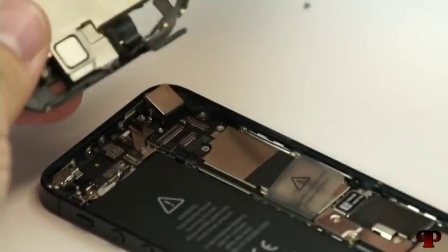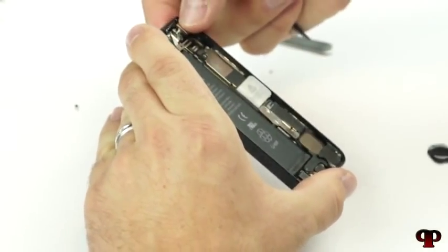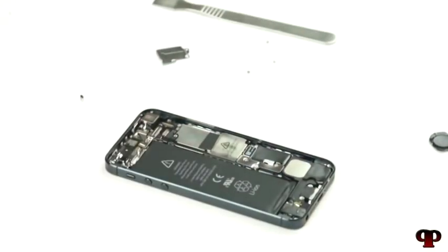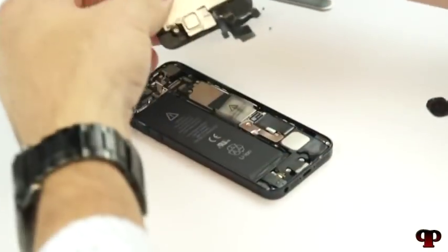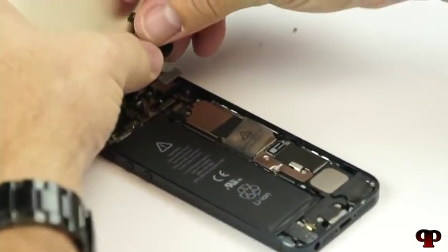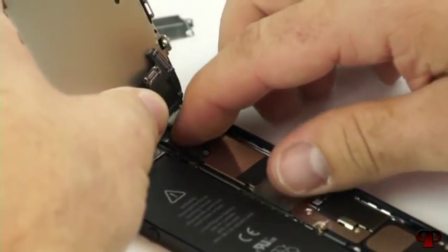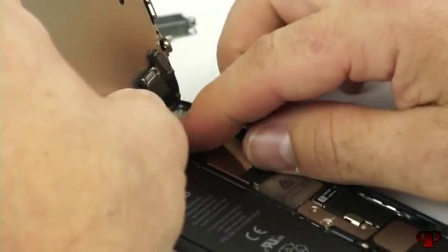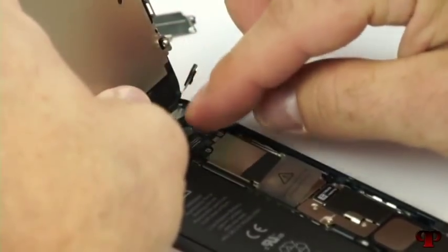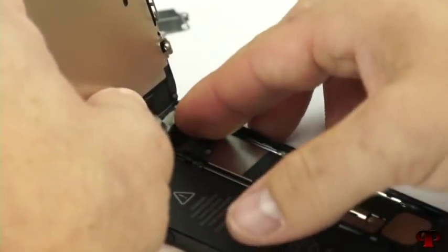The proximity cable also controls the ear speaker. Now our camera is flipped up just a bit — go ahead and push that back down into its little compartment. Take our LCD, peel back these cables, and get that third cable installed first. Be real gentle doing this, make sure that you line it up correctly, then press it directly over that connector and you'll feel it tighten up when it hits its spot. Follow it with the next one, then the last one.